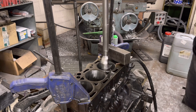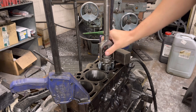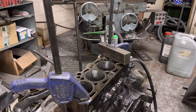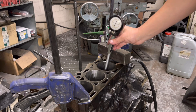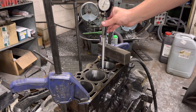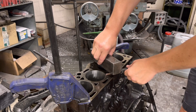I know I've showed you before honing these blocks, but I like to think if we do it several times it eventually sinks in and you learn something new every time. There we go — we're sort of half a thou on top and bottom now, so we're going to leave that one to cool and go on to the next one.